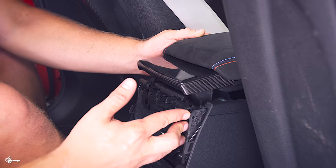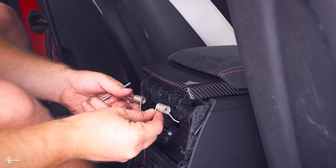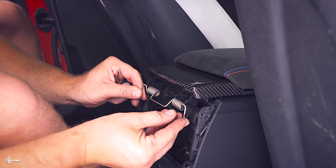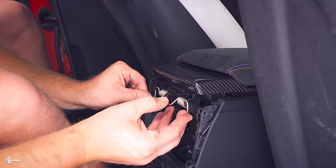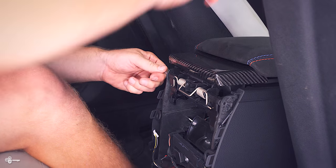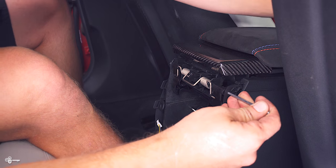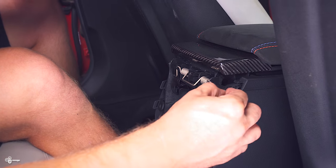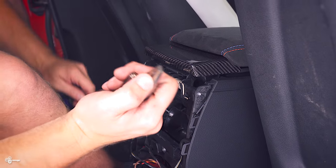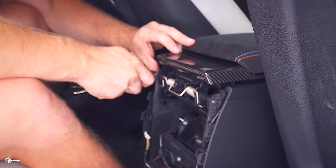When you want to install it, you just press it back in and make sure that that's cleared. You can take your spring — it goes over this piece right there, then under here, then over this piece and then under here. Then as before, you take the pin and just slide it through like that, and that'll make sure everything lines up. Then take your other pin — you might need to move it around a little bit — and just push it in. I like to take the end of pliers; you can use a Phillips head, but this just gives you a lot more mass. Then just push that in so it's flush, and then do the same on the other side.